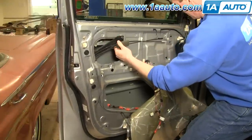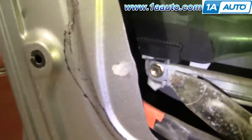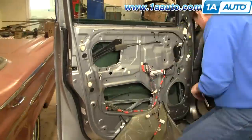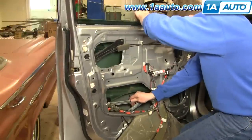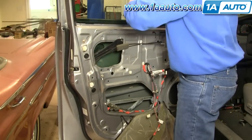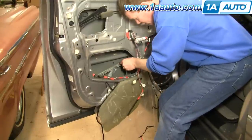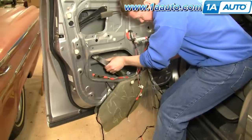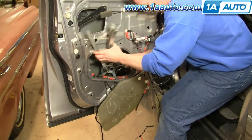I'm going to hold on to the window while I take this one out. Now you can slowly let the window down. I need to remove that bolt there and that bolt there to release the window from the regulator. Those bolts are released — the window is now separate from the regulator. Pull the window back up; tape it with painter's tape and secure it while working the door. Now we can take our regulator right out.